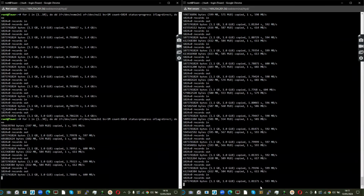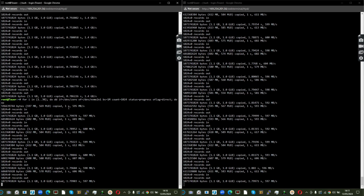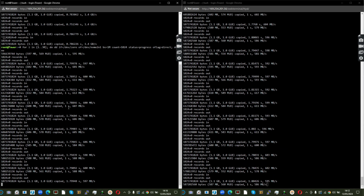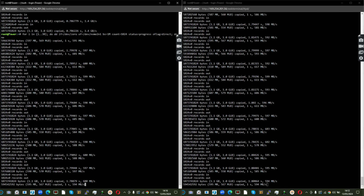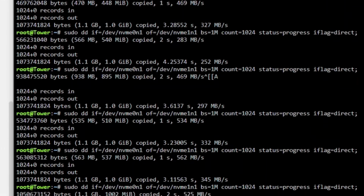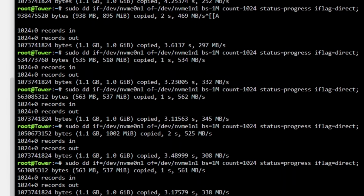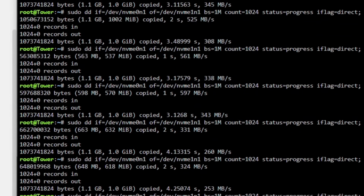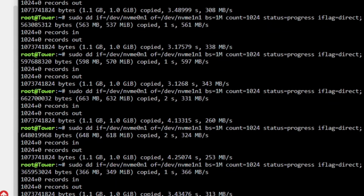It's just very average. And then when you look at the speed of the individual M.2 NVMes, we tucked in again with Unraid going into terminal, then doing some general testing there. We saw with 1 GB test files that the read and write were pretty similar, around 580 to about 610, 620 megabytes per second for each of those slots. But that still kind of showed some real internal bottlenecking taking place. And when we did a copy procedure between the first and second slots, we only saw performance numbers of approximately 280 to about 310 megabytes per second. So again, pretty blah numbers there throughout the whole thing. And that's kind of the big takeaway for this, because it's not a bad NAS, it's just insanely average.